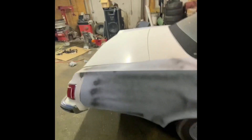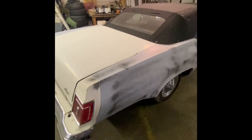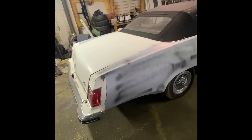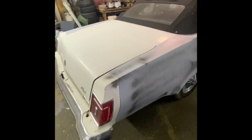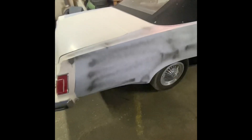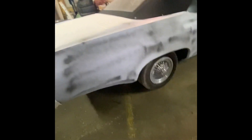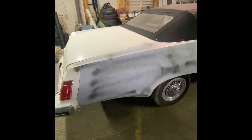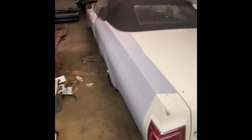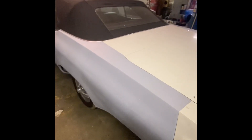Whenever you see that spray right there, that indicates that the body man is in the process of blocking it. I'm not an auto body fabrication guy by any means, but just being down here and getting familiar with the terminology — this process identifies as many waves or warps in the body, which is very pivotal. With these Deltas not being on the market, the quarter panels aren't available for it, so you have to get really cerebral or surgical with whatever modifications you make, because those contours make or break these cars.